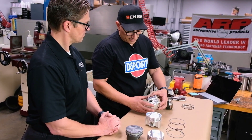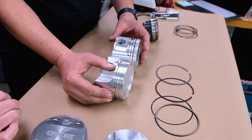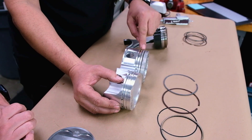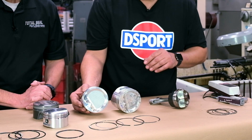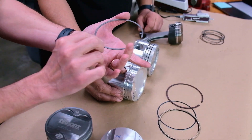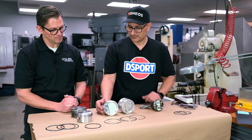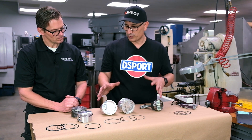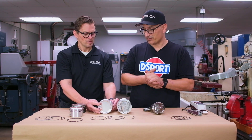Here's an illustration showing the new way and the old way — this is the same manufacturer, Ross. They made this piston here for a Buick Grand National, and you can eyeball the size of those rings. That looks like a 16th — maybe even bigger. That's a big oil ring. Then taking that and moving to a 1.2mm top ring. This is a great combination because we've got a gas ported ring with lateral gas ports in the piston, so we're getting all the cylinder pressure we can and we know we've got good ring seal. This is actually a piston we're going to be doing a test with — going through the Buick Grand National engine, refreshing it, putting some new technologies in it.